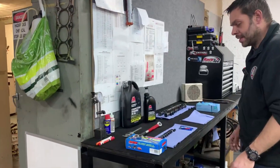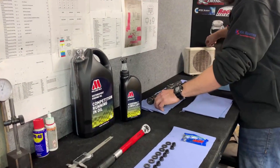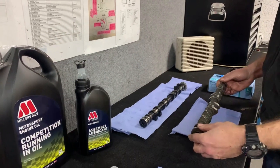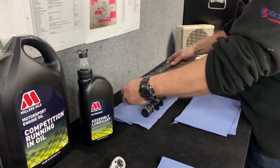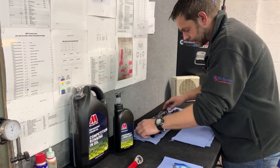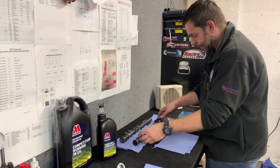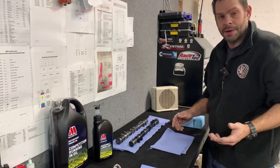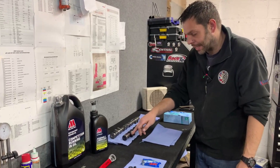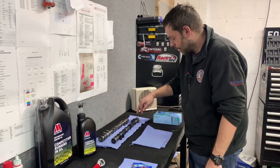I'm just waiting for the cylinder head, but we've got the new cams here. So we've got two cams — the exhaust cam is made from a cast iron piece and then machined, whereas the inlet cam is a full billet cam. The reason it's a full billet cam is because this is a 2.5 — it has the VVT, and the VVT needs a special cam that allows oil to flow through and also supports how it mates to the VVT mechanism, as well as the trigger wheel.